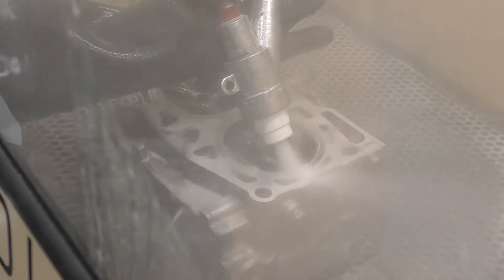Specifically with aluminum, the glass bead is able to roll those pores closed. If you were to look under a microscope, when you're sandblasting you're actually opening those pores up — that's why it looks visually unpleasing, and it also promotes oil getting back onto it. You know how it goes: you sandblast a part, pull it out with your hands, and there's immediately an oil spot. With vapor honing you're actually sealing those pores, which goes back to the clean-by-flow process — one of the major advantages.